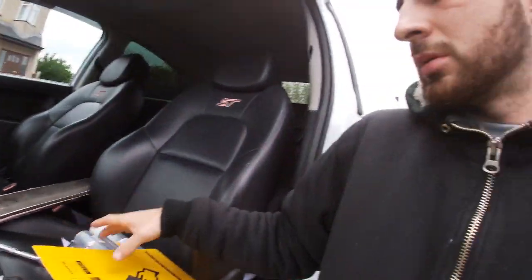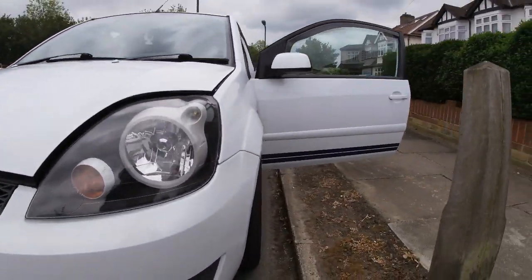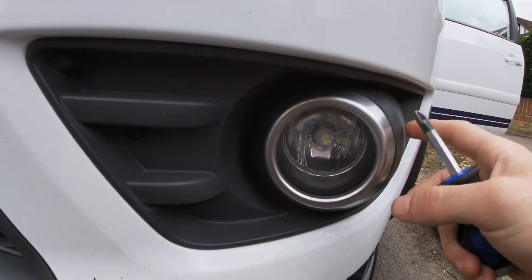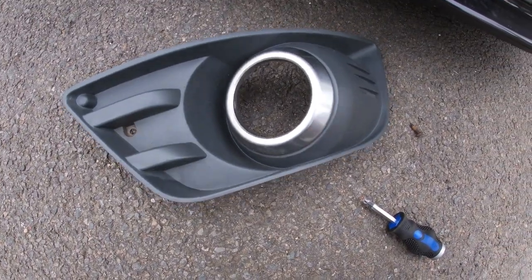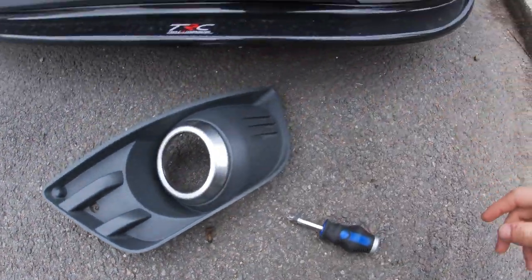So it's now Friday and we're going to be doing the front grills and stuff. I've just popped the bonnet - my skip of a car - just picked up some primer, some more sanding paper and stuff like that. I'm going to open the bonnet up, get the top grill off, unscrew the fog light surrounds - it's just two Phillips screws, I'll show you where they are - and then we'll pull the bumper off to get the lower grill off. There's a screw just under here to get these surrounds off and that's it really. There's the first one off.